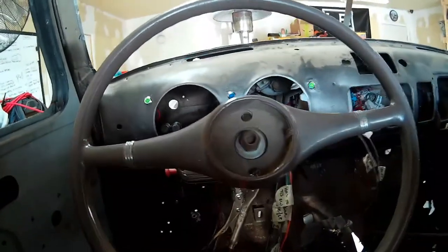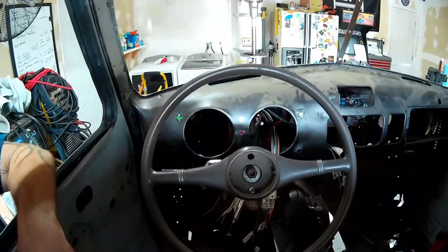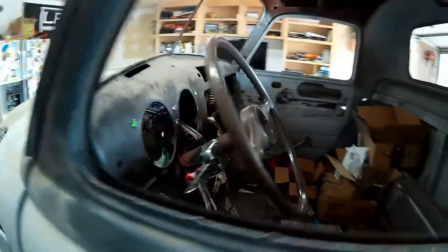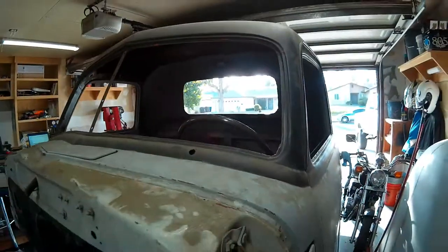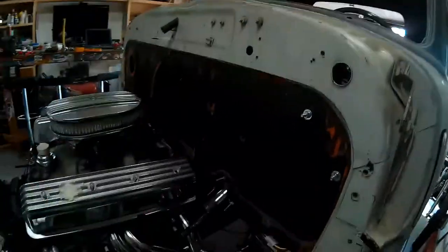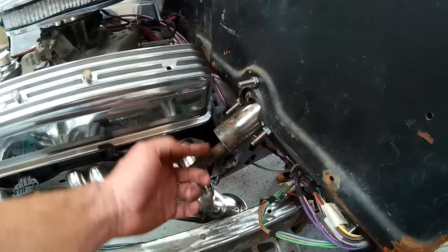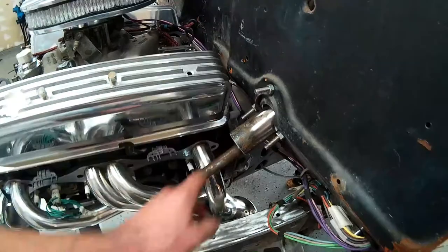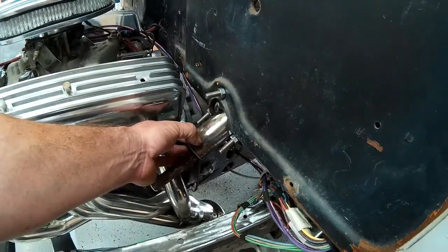Here's our final look at how we're going to have the dash. I think the steering wheel position is okay — I don't think it's perfect, but I think it's okay. And I actually ended up with just the right amount of stick-out on the column here. I left the steering shaft a little long. I'll probably trim it back here just enough for the universal joint to slip on. This column will still probably get trimmed up another three-quarters, maybe an inch.